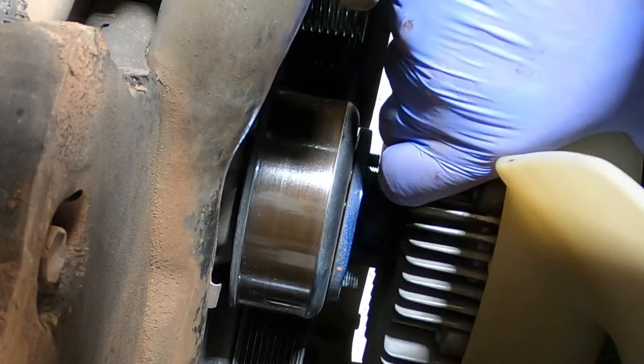Belt is back in place. Next step is to put the intake piping back together and we're ready to go. Now topping up the coolant — the first five liters I'm just going to dump straight in. I have the breather off on the radiator and the breather is still off on the engine block as well. The next five liters I'll take much slower, watching that bleeder valve underneath the intercooler.